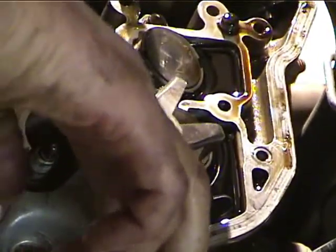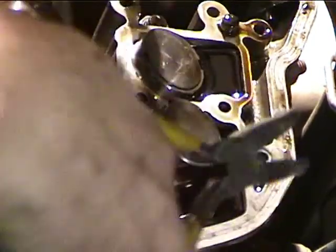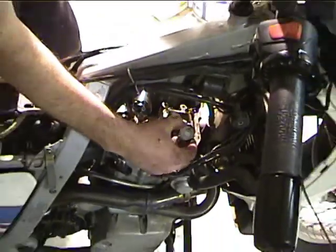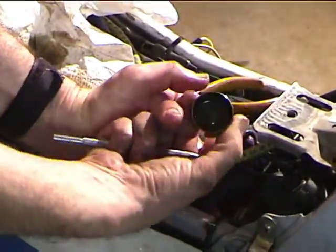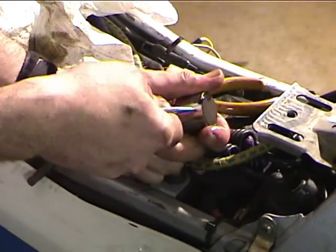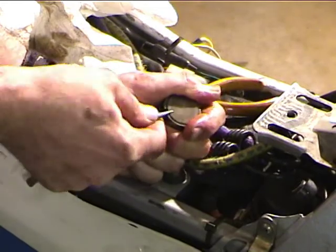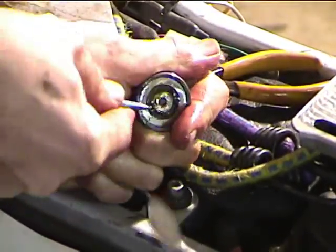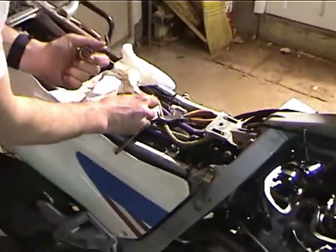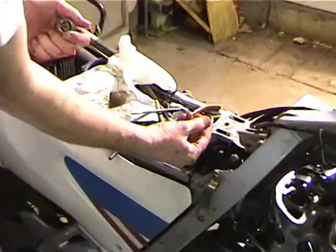So I'm going to try to lift this shim out with a pair of pliers. I'm probably not going to be successful. Okay, so the whole bucket's coming out. This is the bucket that goes over the valve, and the shim's in the top. And popping the shim out's tricky. This is a scribe with a carbide tip, and I tend to have pretty good luck with that. But some people use air, some people can do it with a little screwdriver. There's a shim.